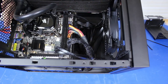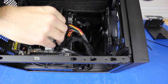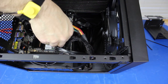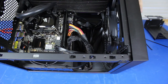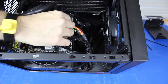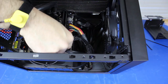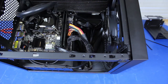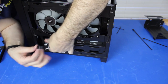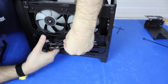So this is the view so far — somewhat clean, could be a little bit better, but good enough for now. We'll install the RAM. One side of the RAM slot is fixed; the top side can be opened up, and as you put pressure on the RAM, the top side will latch into place. Now we'll clean up the various wires from the radiator — the fans and the SATA power connector — just to tidy things up a bit and keep it from being a total rat's nest on the bottom.